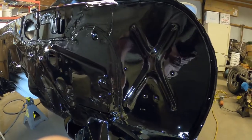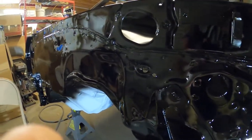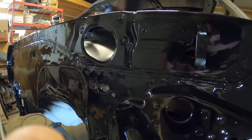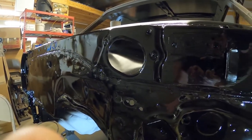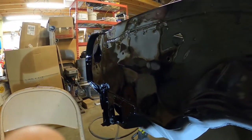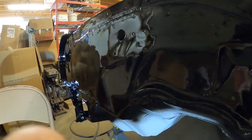As you can see, it's got a pretty good gloss finish. There is a little bit of orange peel on there but I'm not worried about that — it is a firewall after all. My seam sealer line came out pretty good. I wasn't intending on it to be a perfect flat line; I wanted to be able to see it, just knock it down some. You can see a little bit of ripple over here where my airbox used to be, but that's fine.